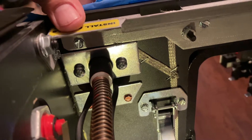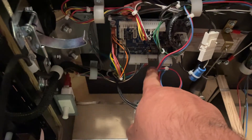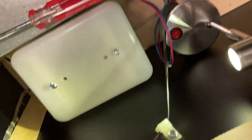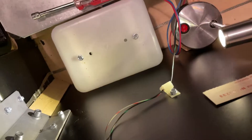Now we've got to hook in the wiring harness. The first connector will go to CN2, and then the second one I believe goes to CN15, right next to the shaker motor. Then we'll run the line all the way to the right flipper holder where the wire is clipped in.